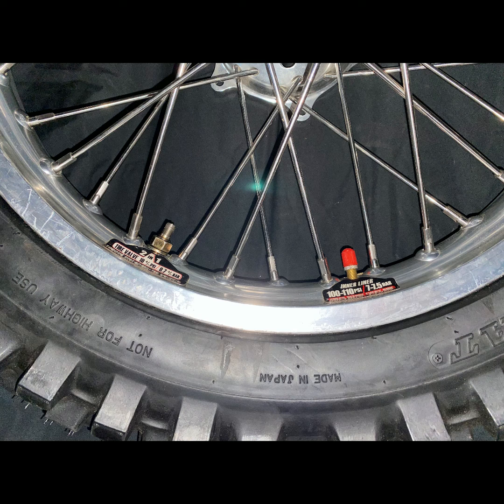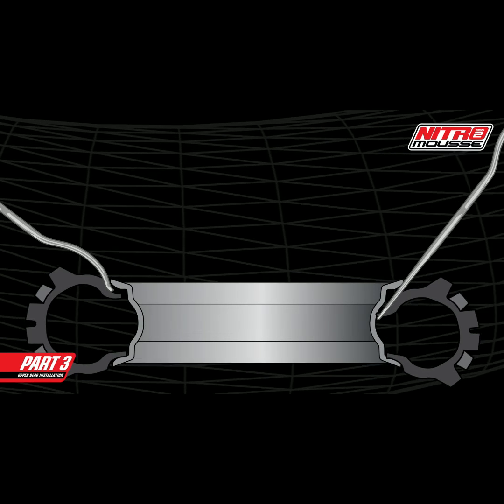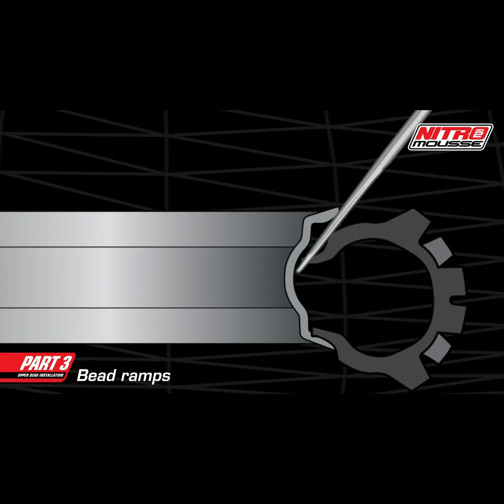To keep this from happening, we put the valves four spokes apart, which is the closest repeat in the spoke pattern of the rim. This allows ample space for the tire to go into the drop center of the rim without causing any damage to the high pressure bladder, ensuring a damage-free install.